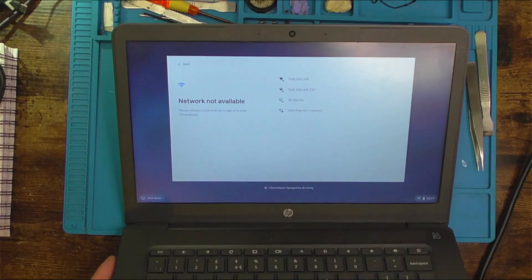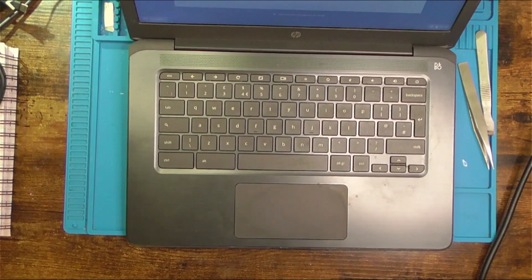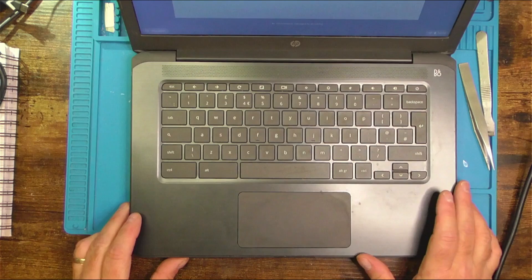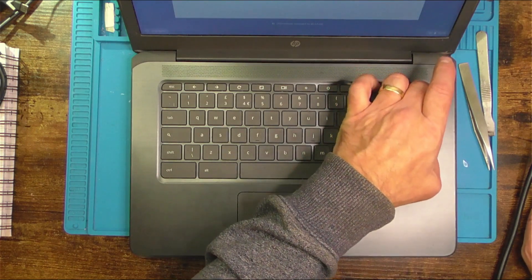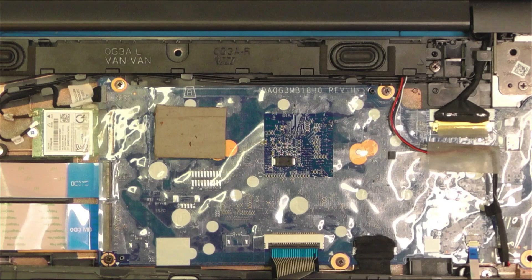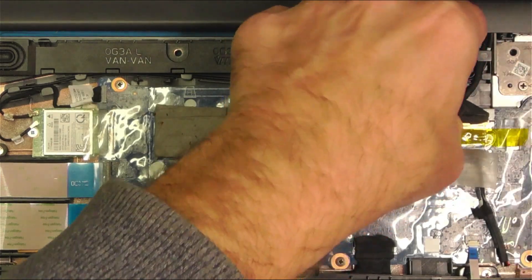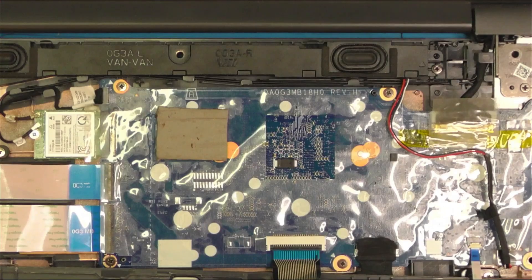So there we go — it's just a rather dulled pin on the cable connector. Wasn't quite expecting that to be quite as straightforward; I actually thought the cable was probably damaged. I'll just make sure that's nice and secure so it doesn't move. The tape that holds it in has completely lost its tackiness, so just to be sure I'm going to put a bit of kapton tape over the top of it, just to make sure it's not going to come loose and cause issues with the backlight again.